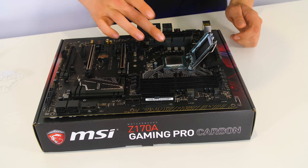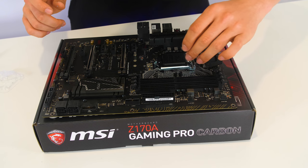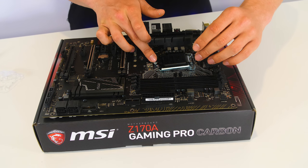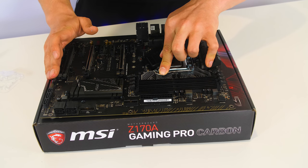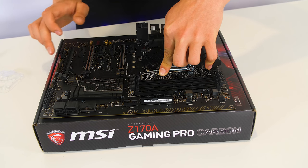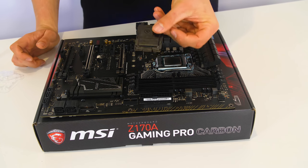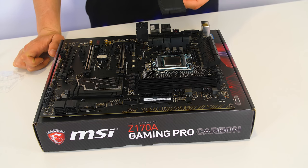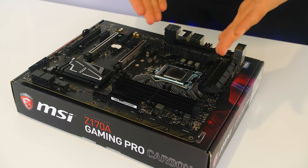Once it's dropped into place, give it a little wiggle to make sure it's in there properly. Then close this up just as you opened it — make sure the latch is under the screw on the motherboard. Push it down; this will require a bit of force and the cover will pop off, which is what we want. Put the latch underneath, keep the cover and put it away safely — I put it in my CPU box in case we need warranty for the motherboard. Now that the CPU is installed, let's install the RAM.